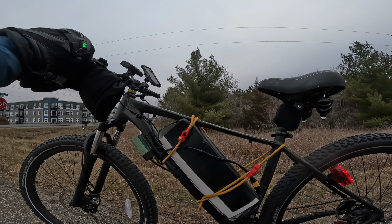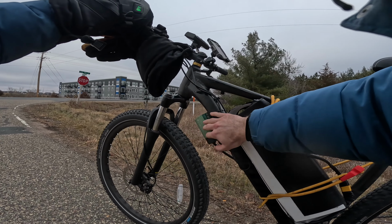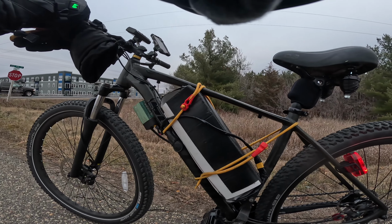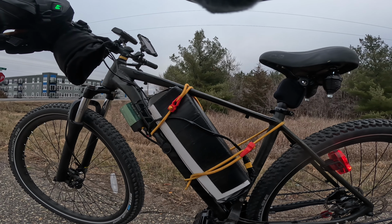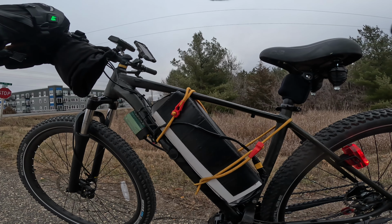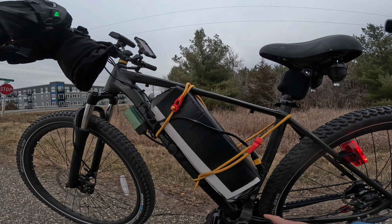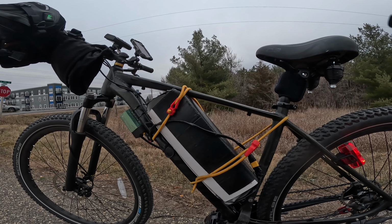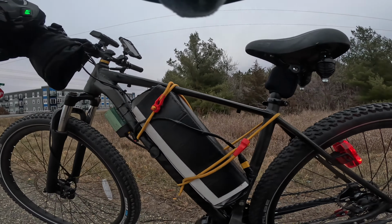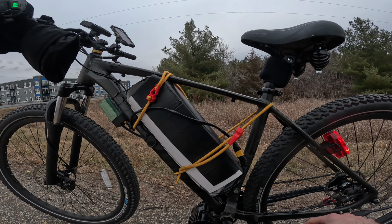So today I'm taking out the 72 volt BBSHD bike, and I've actually put my old Frankenrunner L10 controller on the bike instead of the Phaserunner V6, because I've run into a little bit of a hiccup with the Phaserunner V6 for the BBSHD build. It's related to a limitation in the Phaserunner V6, which is based on the ASI BAC 855 controller. I guess in the ASI firmware version 6, there is a limitation on the maximum field weakening that you can use, and it's a 25% limit.